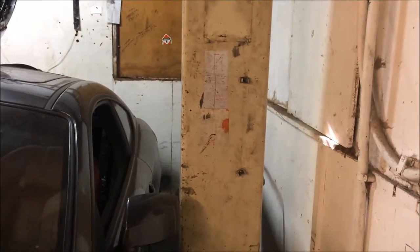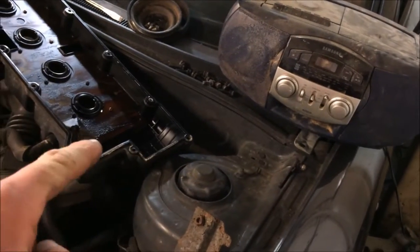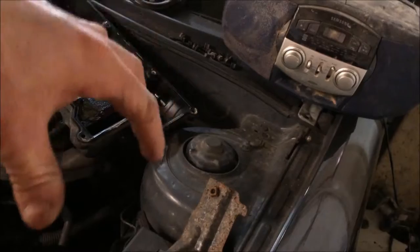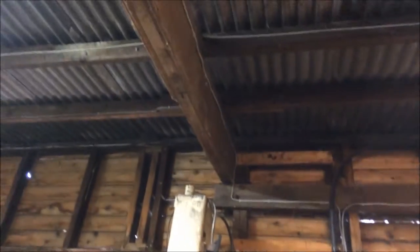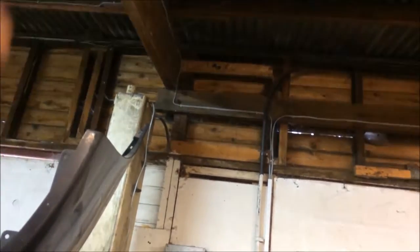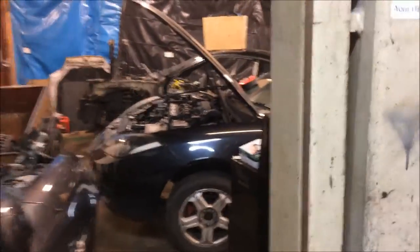There's a three-phase motor and I'm converting it to single phase — new single-phase motor at home. It's going to be a bit longer in length but it should fit. The drive gear coupler is like a three-cone type deal with a neoprene in the centre, then another coupler on the motor into the hydraulic box — that'll just pump the hydraulic pump round to send the ramp up and down. Need to move the ramp to the other end of that beam, and the roof wants a hole in it because that bar goes up — a bit like a drainpipe tube — so I can send the car up. It doesn't seem a bad ramp. I'll end up with a decent ramp for about 500 quid, and it's single phase so if I do go into a bigger unit I'll be alright.